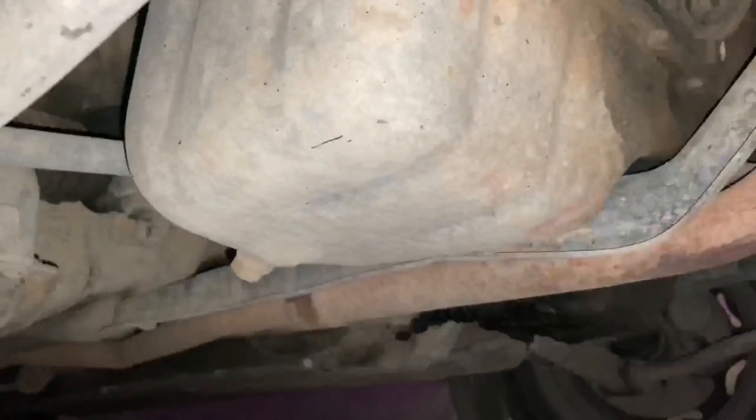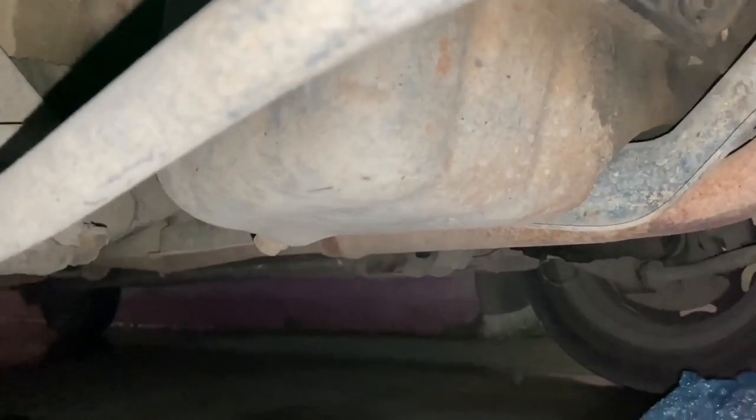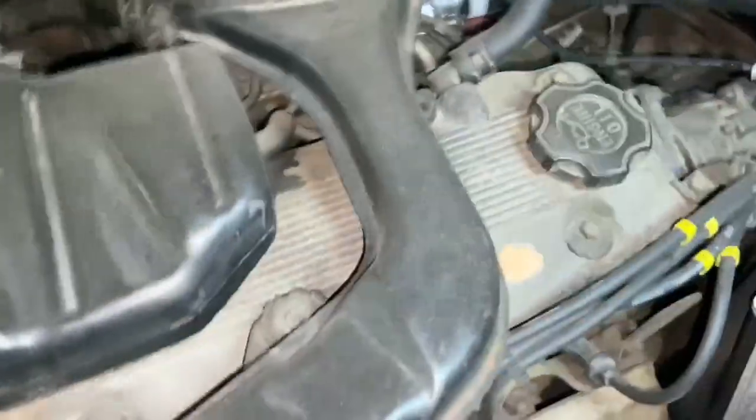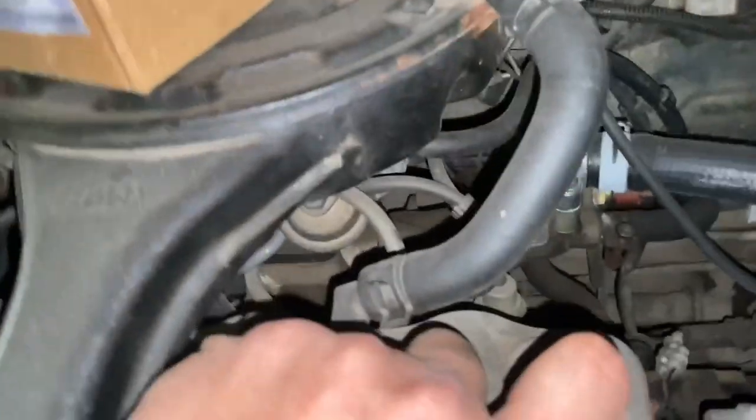Let me show you how to change the engine oil, oil filter, and air filter — it is one of the easiest DIYs you could do. If you crawl beneath your car, you will notice a sump for the engine. Every engine has a sump located at the bottom which collects and stores all the oil used for lubrication. Every sump has a drain plug used for draining the oil. I've got a container here to collect the drained oil. The engine oil is best drained when the engine has reached its operating temperature, as the oil flows much faster. Slightly loosening the cap permits the oil to flow more quickly — loosen the engine oil cap and keep it aside.